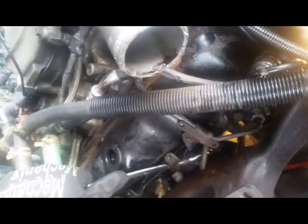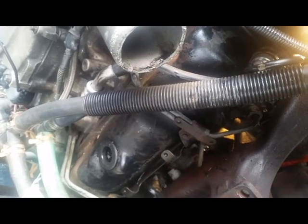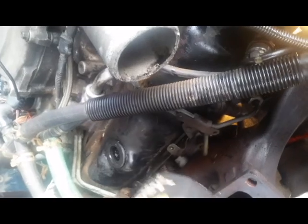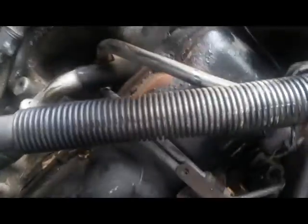As far as the injector itself goes, not too bad. Undo the line with a 19mm — I don't know the exact spec, assuming it's German-style good and tight. Give it just a little bit of PB Blaster to help break it loose.